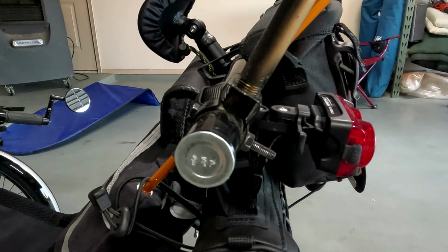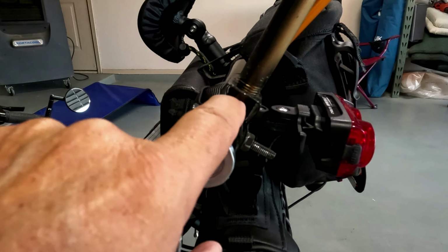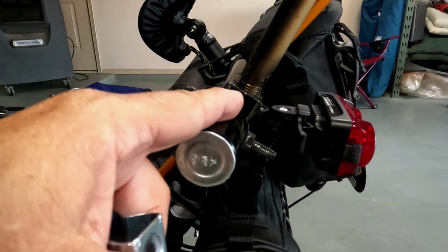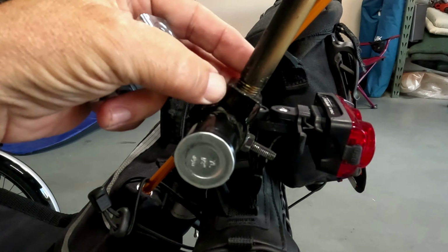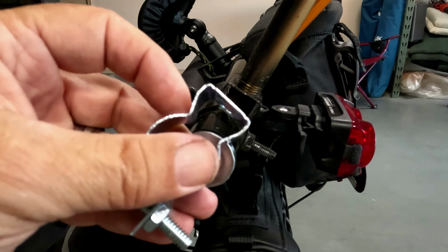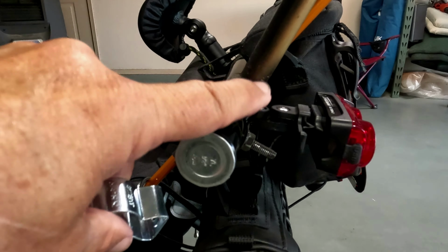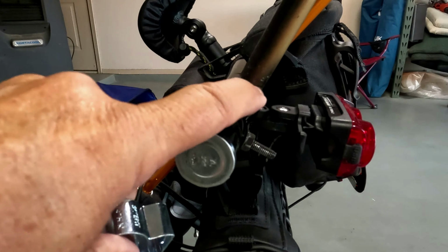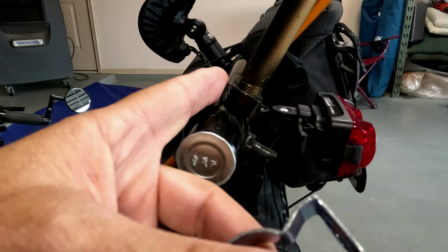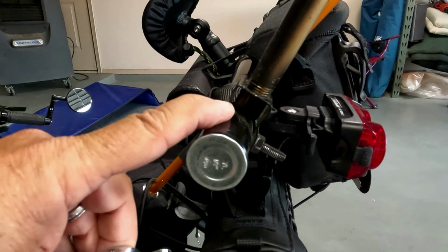So when I was at the hardware store buying these components, I found a nut that was small. It's in the same plumbing section. It was small enough to go inside of this bracket here. I had to open it up a little bit. You can see it's a little bit wider. And the top's drilled out to accept the size of the threaded portion. And that nut is what's holding this up against this bracket. And it bottoms out on the PVC nicely.